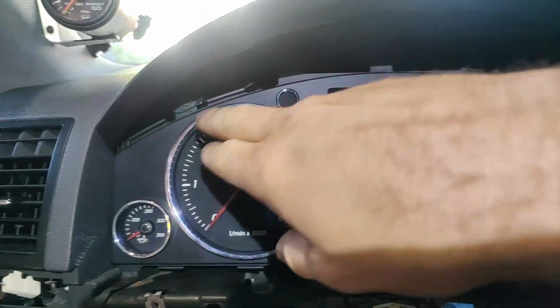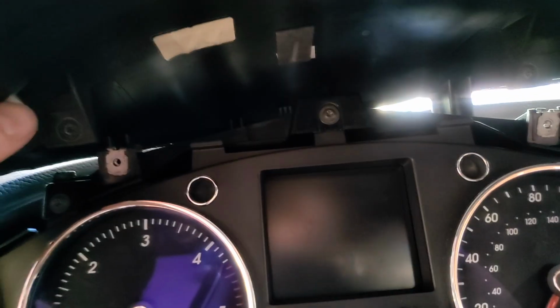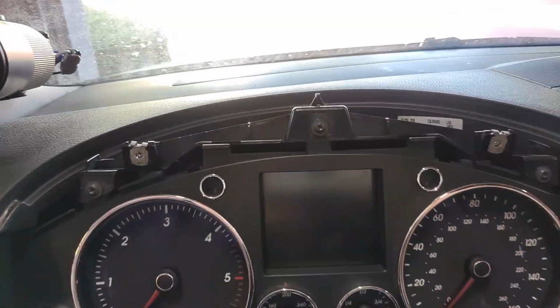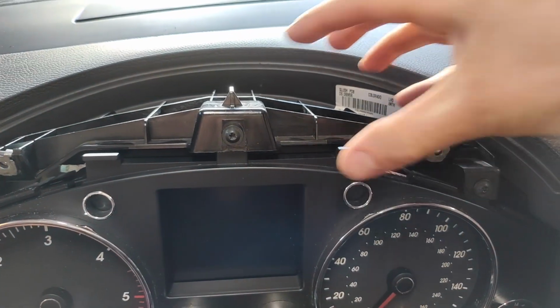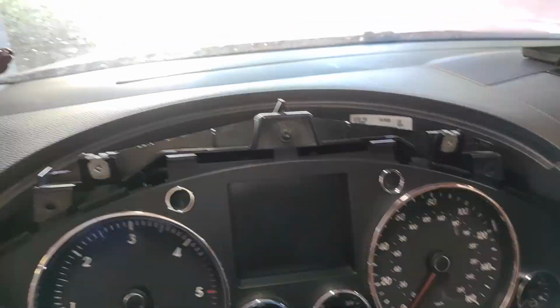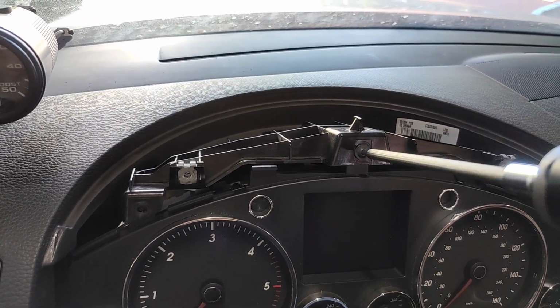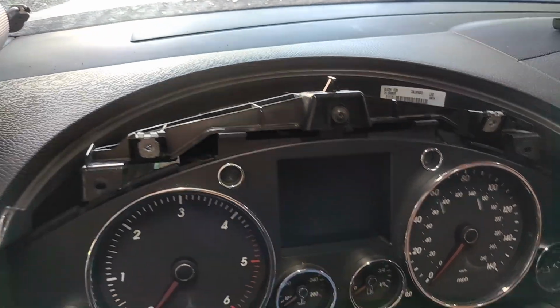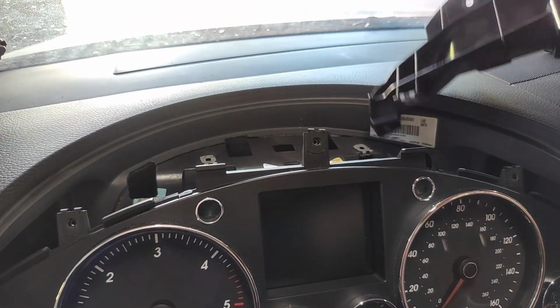There are a couple of screws up here that we'll want to take out. The bimini comes off with two screws here, and then you slide it forward. Then we'll be able to access two screws back here and these two that will take this center section out. So I just loosened those four screws. Oh, I forgot the fifth one in the center, so let's do that quickly. Hopefully I won't drop it after we take that out. Remove this piece. Again, there were two back here. You can see one there and one there.